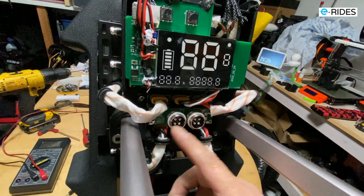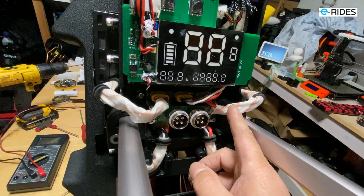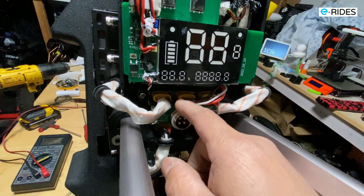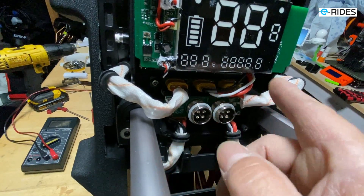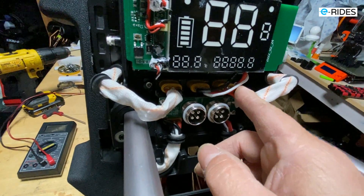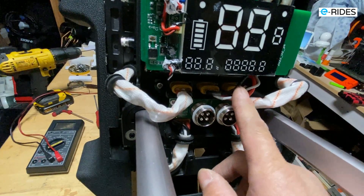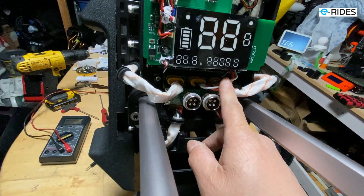You've got four batteries and you rely on all four. If any of the batteries fail, then the wheel will stop working because they're all wired in series. The charging port has a circuit which manages the battery — it adds up all the batteries and gives you 133 or 134 volts to the control board. The control board requires that kind of power to run. So if one pack is disconnected, there's no power going to the control board — there's no redundancy power to the wheel.